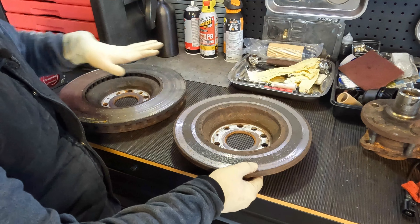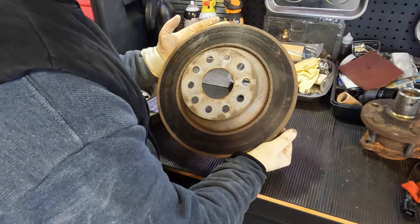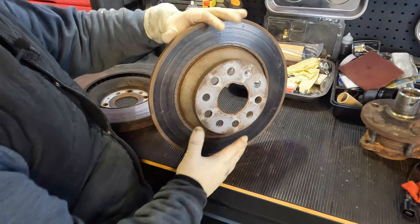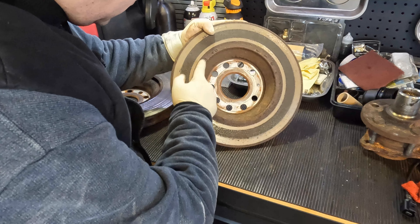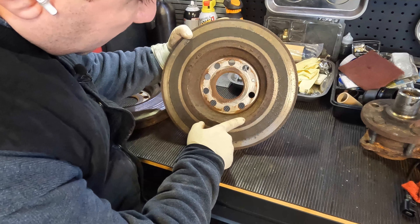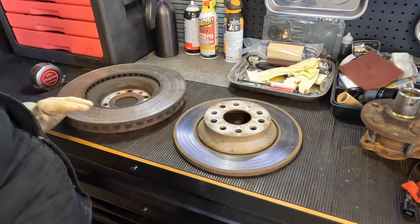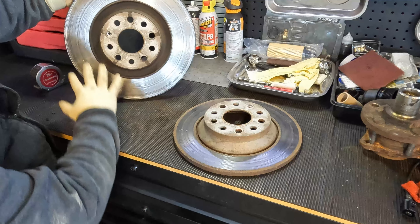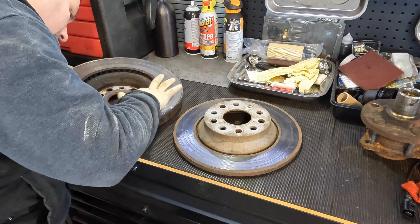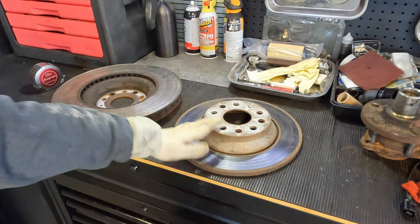Make sure you're measuring from the back side, not the front side. Another tip: sometimes there may be a stamping on the rotor. On these I've looked and don't see a clear indication, but if you're lucky you'll have a number or even a part number stamped on it that will tell you which size it is. This one does say VWAG, and some random codes like FT66 and TL011 — I'm assuming those are tolerances for machining. The front rotor has no numbers at all, which suggests it may have already been replaced before, since factory rotors normally have stampings. So the rears could be original and the fronts already serviced — that could be the case.